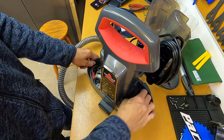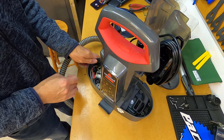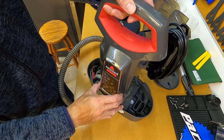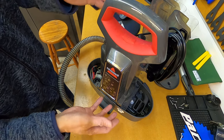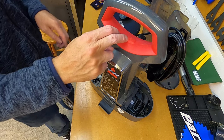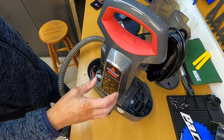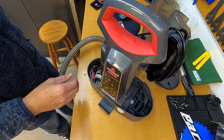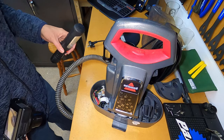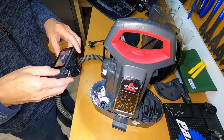So we've removed both screws that hold this hose in place. Now we want to give ourselves better access to this black piping that runs to the pump. You can just lift this middle handle unit up — you'll probably want to leave it about there. You won't be able to lift it completely off as you've got wiring that runs to a middle switch here to turn it on and off, and you've also got the mains cable that runs through the back of this handle. But by lifting it up, we still have enough access to get into that black piping. Now I'm just going to get a close-up of the hose clamp that we need to loosen off here.